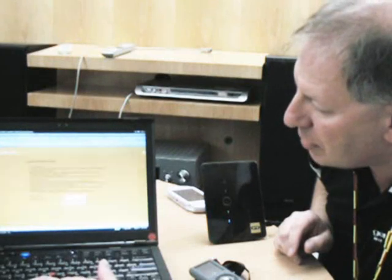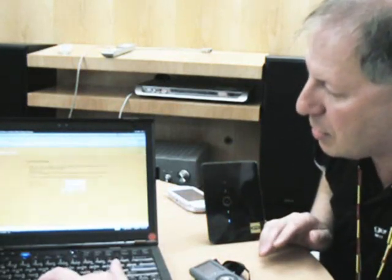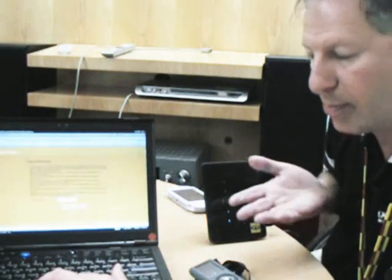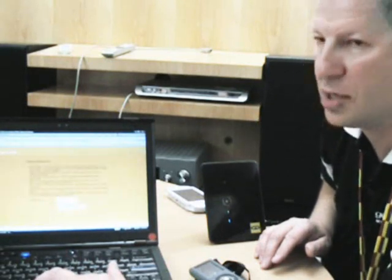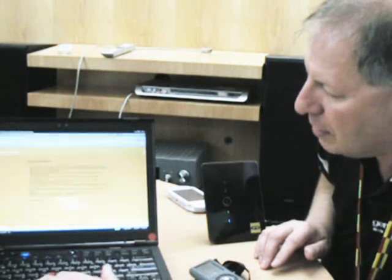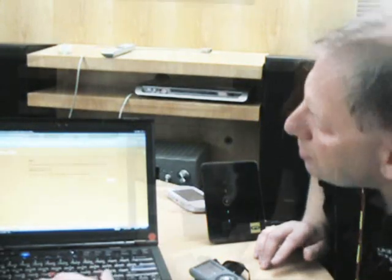And that is the setup screen. Just to go through all of the setup — click Next, everything is predefined for you unless you want to change it. Next again, predefined. That is how it connects — whether it connects permanently or on demand. That is its SSID, the name that it broadcasts over the Wi-Fi network. The next screen is whether you want any form of encryption like WEP or WPA — WPA PSK definitely seems to be the more secure one. We'll leave it unencrypted for now. Next — basically check your settings, click Finish, and the device is now completely configured. That is all an average user needs.